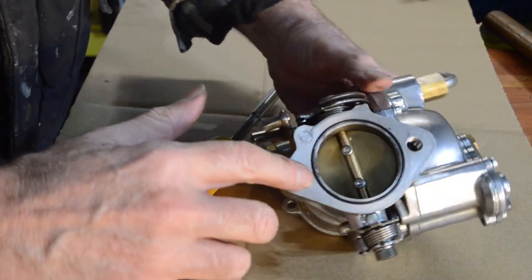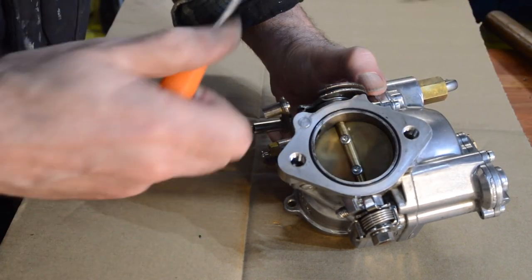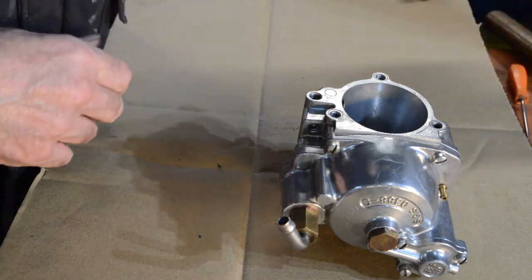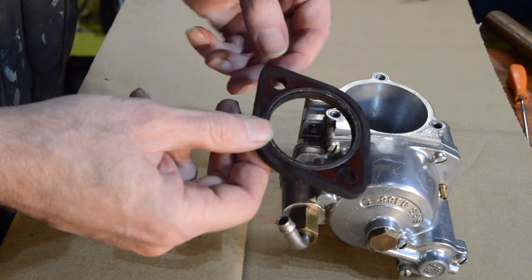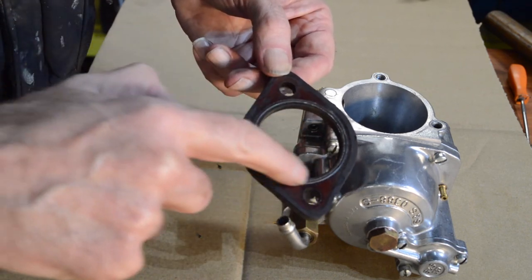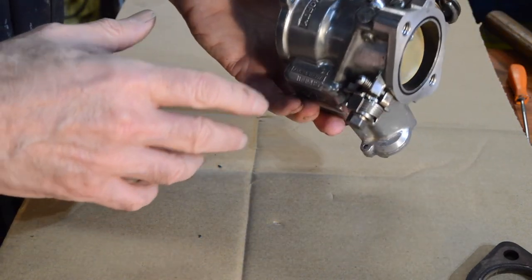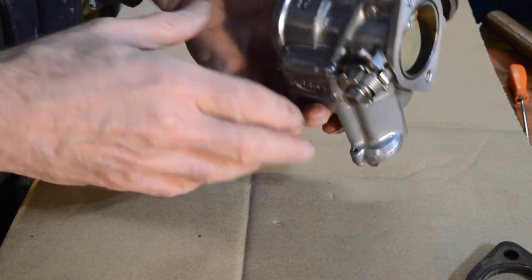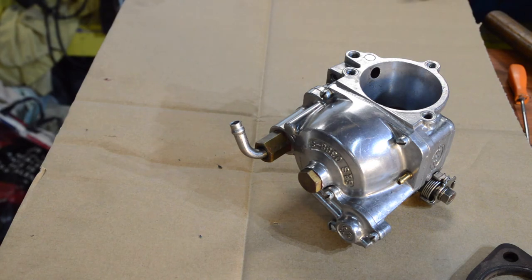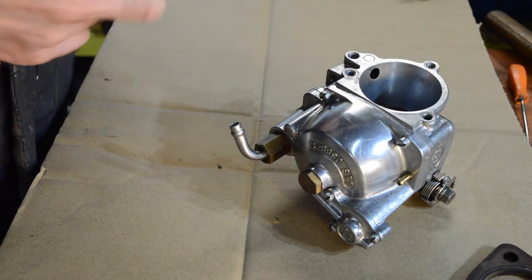That leaves our O-ring which I've already replaced - the camera cut out while I was doing it, but I just used a pick to get the old one out and the new one went in perfectly well, a bit dirty from sitting. So that's it - that's our carb. There was another O-ring in the kit which I thought was for the spacer but it was the wrong size, so I'm not sure what it's for. On mine the existing one is still well proud of the surface so a little smear of rubber grease when it goes on will do fine. The only other thing is to refit it and fit the overflow pipe, which should be a push fit - but it won't go, so it's going to need warming up.